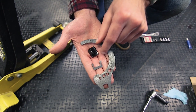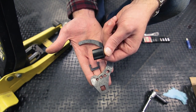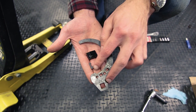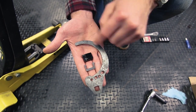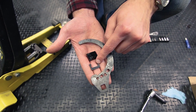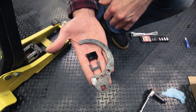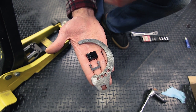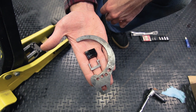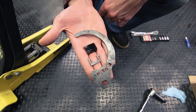This is all you're going to need to install the cam phaser limiter. You have this black piece which is the actual phaser limiter, and then this two-piece jig — this is like a crescent wrench that you compress the spiral spring with and it will lock it in place. Some kits also include a bolt to keep everything together so it doesn't spring apart. We'll have a link to this kit in the description below.